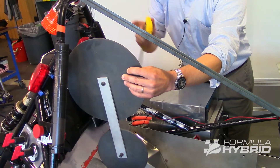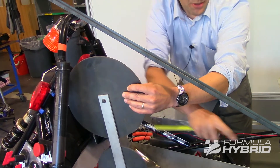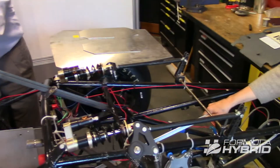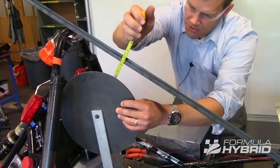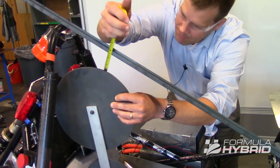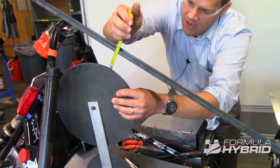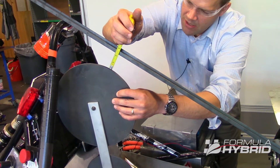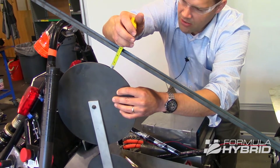Looking closer at PERCY, I've put a bar that extends from the rear roll hoop to the front roll hoop. We measure from that bar down to PERCY's head at a perpendicular. By design rule, PERCY's head must be two inches below that bar. Failure to meet this rule is a failure of PERCY, and as the rules are written, that would be a failure to earn a tech sticker.